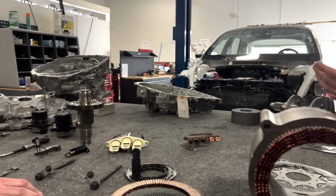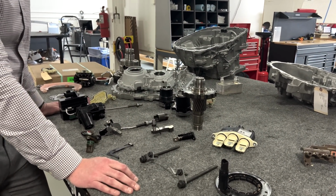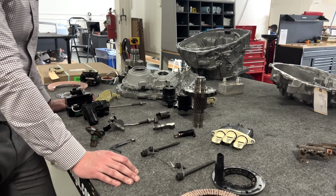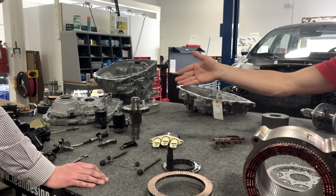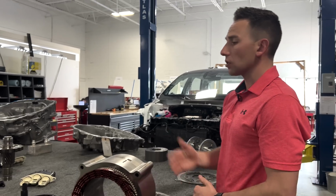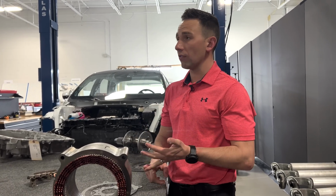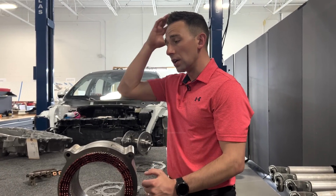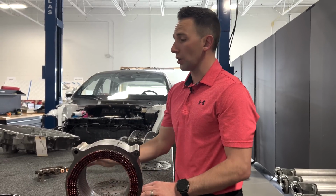There are multiple machined components, and any number of threaded fasteners to engage all of these. There are machined fits and surfaces, so a lot of cost. There are integrated circuits, PCBAs, and powdered metal components. There's a lot of stuff going on there, and these are things that we would generally not consider lean design. Yeah, we don't encourage springs or threaded fasteners because they typically yield, of any type of component, higher quality and failure rates and concerns.